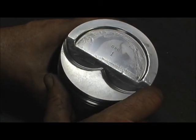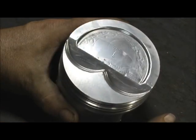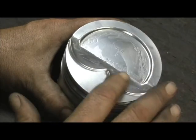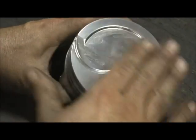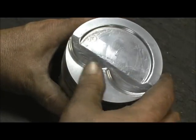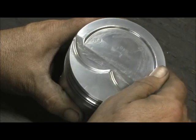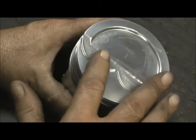According to the Keith Black book, what that does is — where the CNC cutters went in and cut the top of the piston, leaving the pores open — when you go in there with that compound and concentrate and polish it really fine like this, and I mean this is a fine polish, probably 400 grit, smooth to the touch, it builds a thermal barrier almost like a coating on top of the piston.